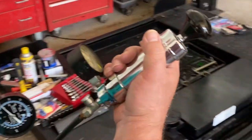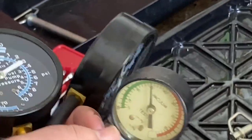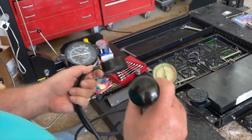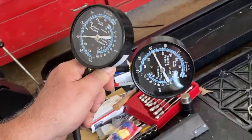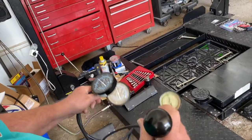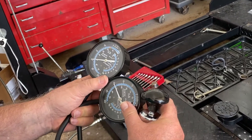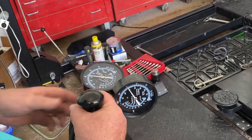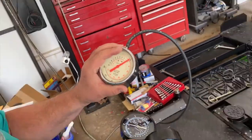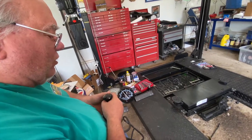In my right hand I have a vacuum tester. It has a small vacuum gauge on it, and if I hold it and pull this plunger back, I can pull down a vacuum in a closed system. In my left hand I've got two vacuum gauges. I have two because I wanted to check the calibration between both of these and this vacuum dial on the tester, to see how close they are to each other. I have yet another tester or vacuum gauge, and I found it is off by about one or two inches of mercury on the dial compared to the vacuum tester.